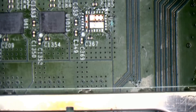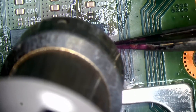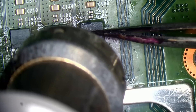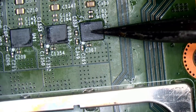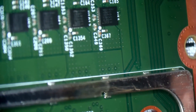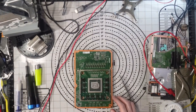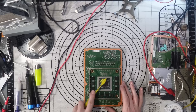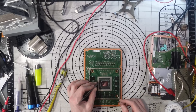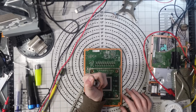Good enough - MPS 86965. Beautiful, better than OEM. With that replaced, this console should at least attempt to power on. The reason I got confused earlier is I got mixed up with whether it isolates the APU or the 12 volt side. Should have known better - I've fixed many of these things. I promise I do know what I'm talking about, I just got confused for a minute. It happens to the best of us. Thermal paste, cooler, nuclear reactor...